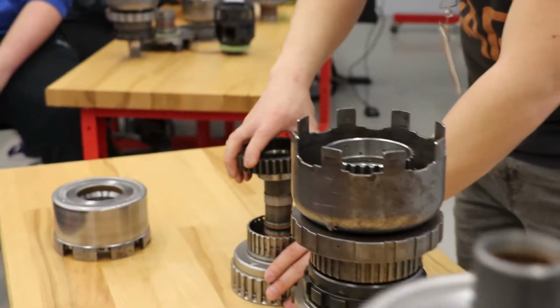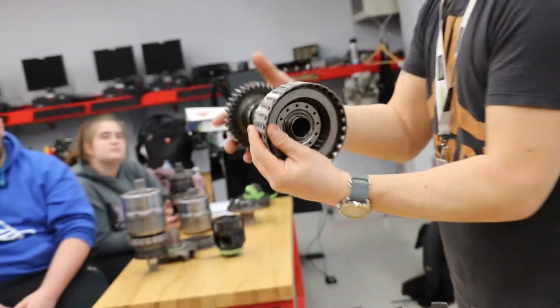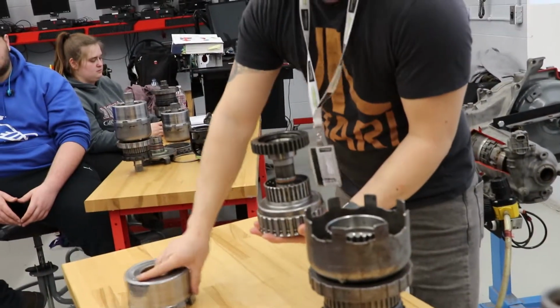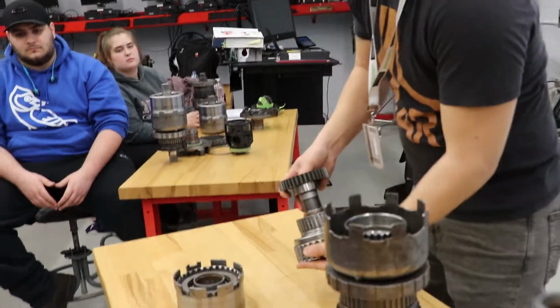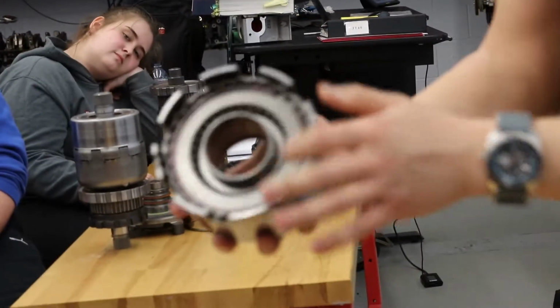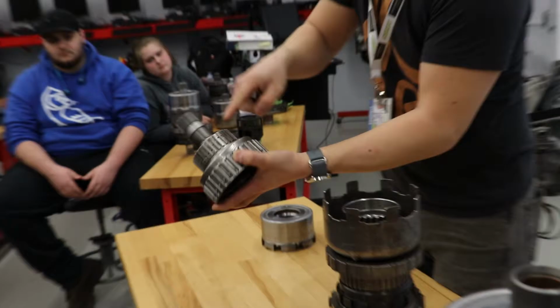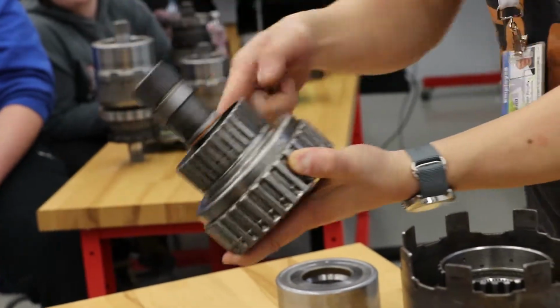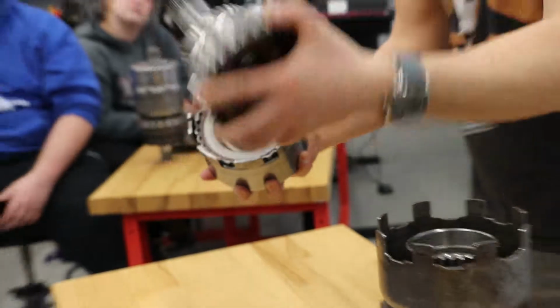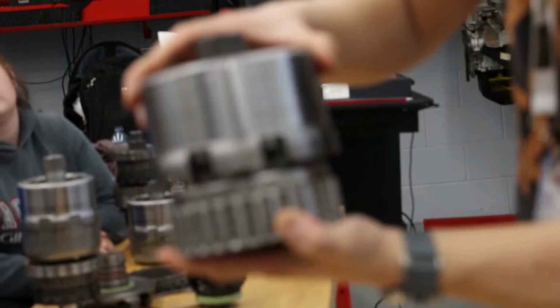Drive chain, driven sprocket. Driven sprocket drives forward clutch clockwise. Again, clockwise from this direction, in the direction of vehicle travel. The direct clutch, which is on the internal side of these clutches, gets applied. And when these clutches get applied, they send torque to the forward clutch shell, as shown here. These spline into your direct clutch plates.